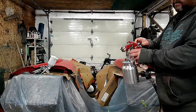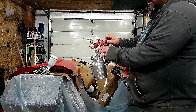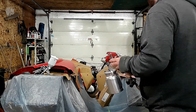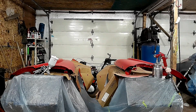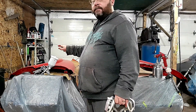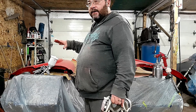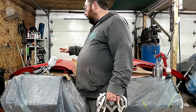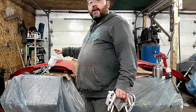We've got our guns set up here. I'm going to back it off all the way to get my gun set up, then turn those in three turns — that should get me pretty close. You like that green color? Now this gun I picked up from Amazon, I paid $35 for it, so I really have no right to complain. But if I had one complaint about it, I'm not very fond of the cup — it's hard to get started. But once you get started, I haven't had a leak with it yet, no drops. So for $35 I'm not going to complain, and for that money I can recommend that gun.